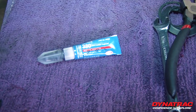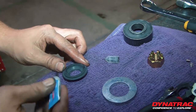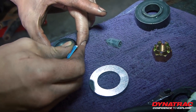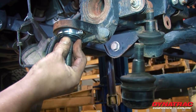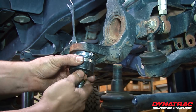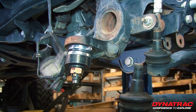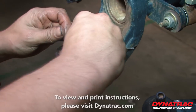When you want to prep this boot, use Loctite 380. There's an inner ring and an outer ring — put the glue on the outer ring. You don't have to apply a lot of pressure, just enough to put a nice clean bead on it. Then install it, making sure it seats evenly all the way around. Run it on hand tight, as we need that glue to set for about three hours before it's driven — this way it'll apply pressure and keep everything seated for the knuckle assembly. Once the glue has set, reinstall your pins, and these just have to be hand tight.